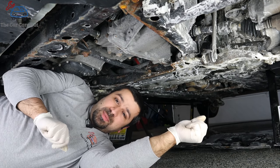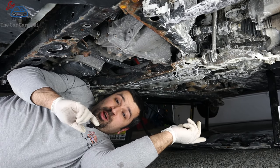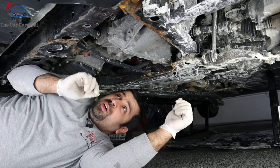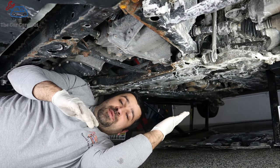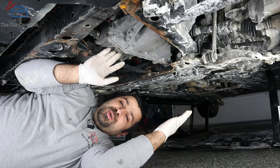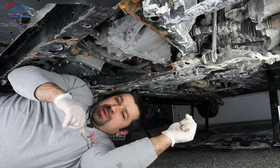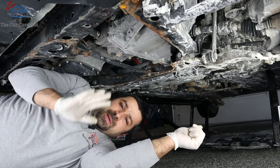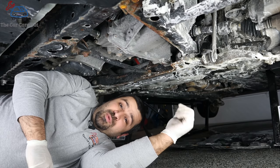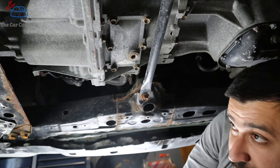You're going to want to lift the car up. You can lift just the front — I'm using a QuickJack so the whole car is off the floor. If you're using jack stands, you can lift just the front up. When you drain the inverter coolant, you do want the car level, so maybe lift it up, have the coolant start draining, then lower the car so it drains all the way. Now let me show you the drain — we'll start draining.